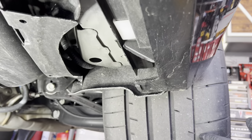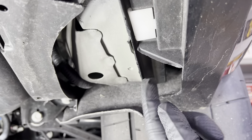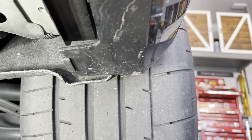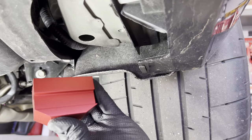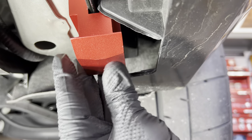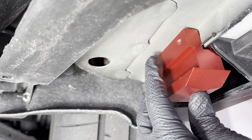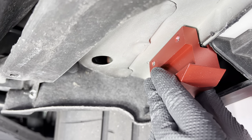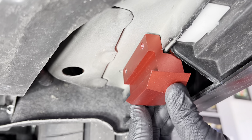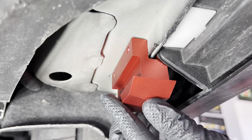So this is the rear of the vehicle — we're going to start here. You'll see this little almost white retaining clip for the body panel, and then we've got this plastic ridge almost. What you'll want to do is take your lift point, find that ridge, and line up the lift point right there. Slide it forward and then, using the Allen key, tighten it up and get it nice and tight. That'll pinch it together and it'll be solid from there. You'll always be using the pinch weld to lift the car, whether you're using a lift or putting flat top jack stands or regular jack stands on it.